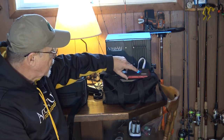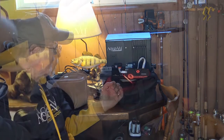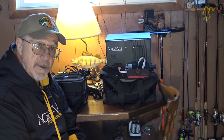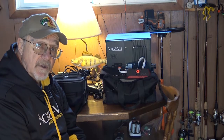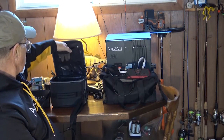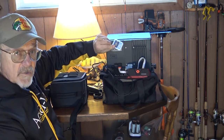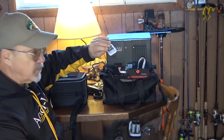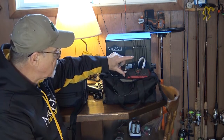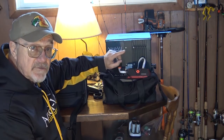When you want to record, all you need to do is hit that button and it'll start recording. It goes red and the flashing red indicates that you're recording. You're going to want to get a 64GB or even more SD card, but I run 32GB and generally speaking it does the job. You'll need a class 10 card — don't try to record on a class 4 or 6; it's not going to do the job because this is extremely high definition video. This unit exports in 1080, so your video will actually be 1080 at 60p.